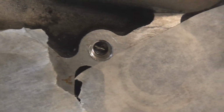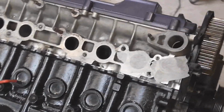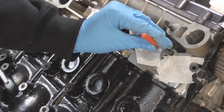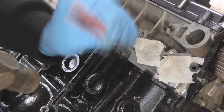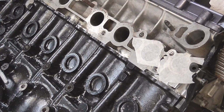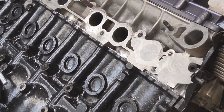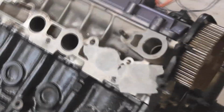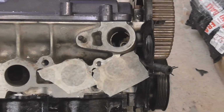You can see that it's got a nice strong thread now going down the sides with the tang. There you are, you can just see the line going across the hole at the bottom. So I'm just going to break that off and get that out. Make sure the punch gets to the bottom. Now, you might not always be able to break it off, especially with it being in an enclosed hole on this one. So what I've done is I've pushed it away so it doesn't stop the bolts from going in.